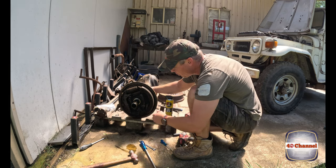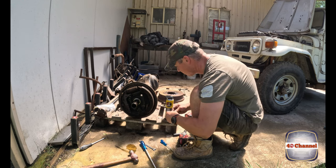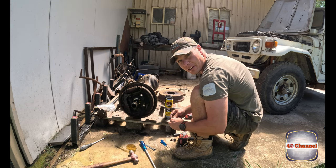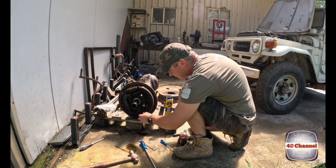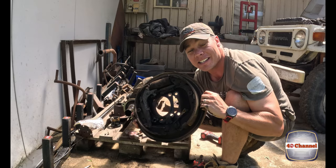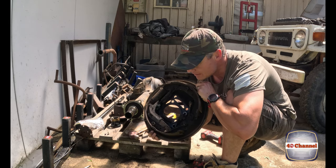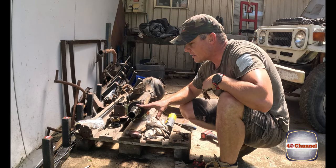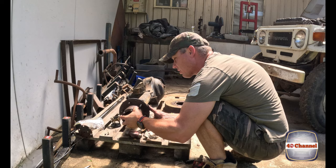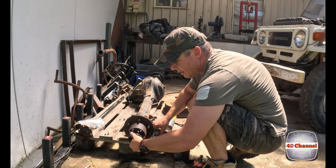You may need to put a little pressure on the back bolt to stop it spinning. We're going to keep all the nuts and bolts - the reason is we just don't know what the troopie is going to be like. Hopefully it'll be in good condition, and if you keep everything and find any issues later you can reuse some parts. That is what we need for our handbrake conversion on the 40 series Land Cruiser - the stub axle, the hub, the whole lot is all in good nick. We'll throw the hub back on just so it stays together as a unit.